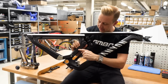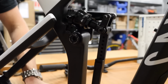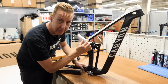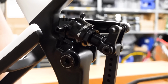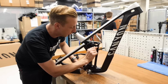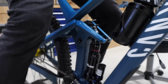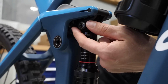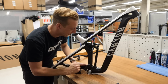It goes right down here, down the seat tube and up the down tube here. Very simple and very easy to work out what's going on if you have a good look at it. This is the actual Shapeshifter 2.0 unit. Now look closely here and you'll see what's effectively a small stanchion tube. So this is extended in the uphill position. When you click the shifter and you sit on it, it squashes down and it dramatically changes that upper mounting place of the shock, and that is what's crucial to how this bike performs and how it rides. And I think it's a really neat system.